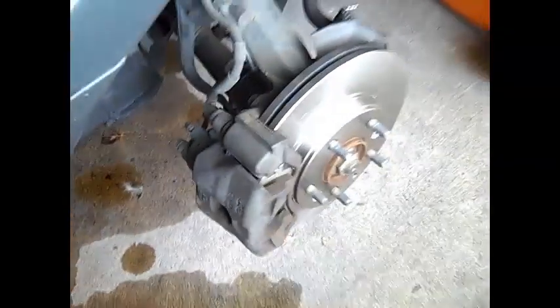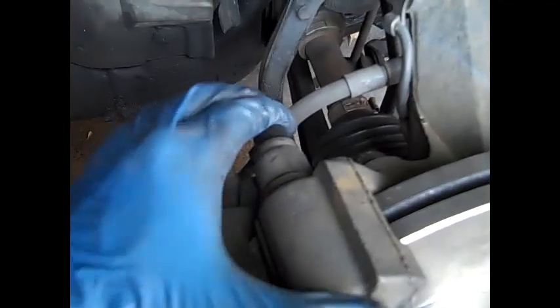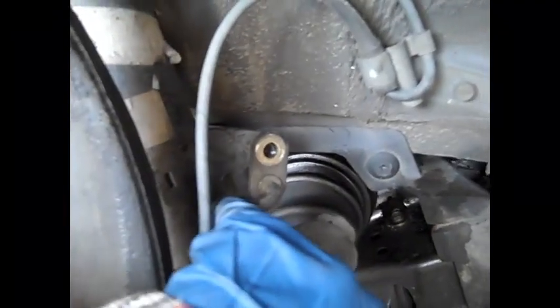Now it's ready to slide and push that pin back. It's in place and ready for me to tighten down. I've tightened up the upper pin. Don't forget to put your little cap back on to help protect and keep it clean — it just snaps in there, turns, and it's snug. And don't forget to reroute your brake line back — it kind of goes under and catches there. The holes line up and put the nut in and tighten it down.